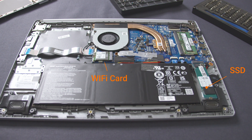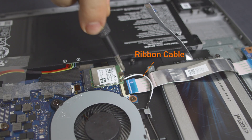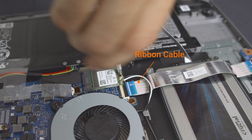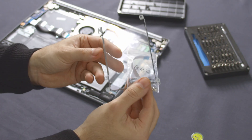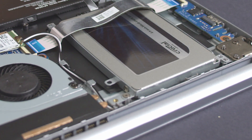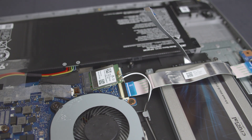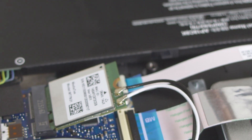A bit more to the left of the SSD you'll see the Wi-Fi card, which you can replace the same way as the SSD if the need ever arises. Right next to the Wi-Fi card you'll find the socket for the ribbon cable that you will need to hook up the SATA SSD. Acer has already provided a little plastic bag with all the necessary accessories to install — if your Aspire 5 came without those, we'll provide a link in the description. Screw the included SSD enclosure to the SSD and then place it to the left of the battery. You can screw it in place and connect it with the ribbon cable, but first you must remove the screw that holds the Wi-Fi card in place, because the Wi-Fi card is blocking the port for the ribbon cable. Don't forget to initialize the SSD in Windows with a disk management tool.